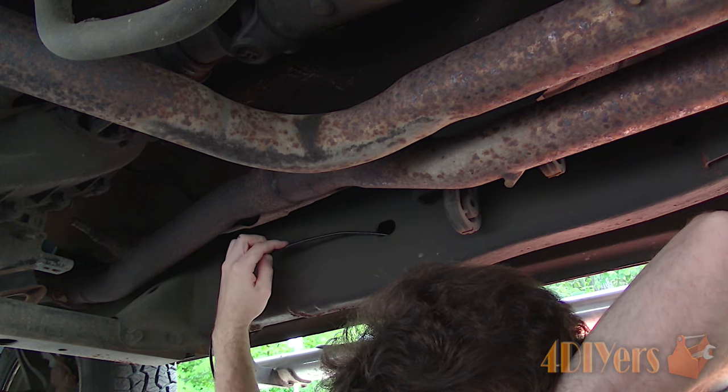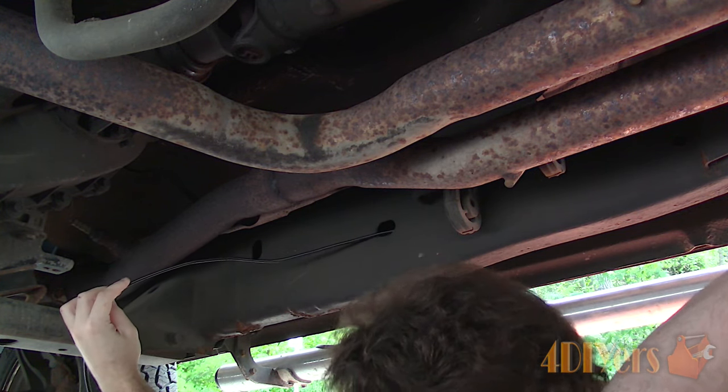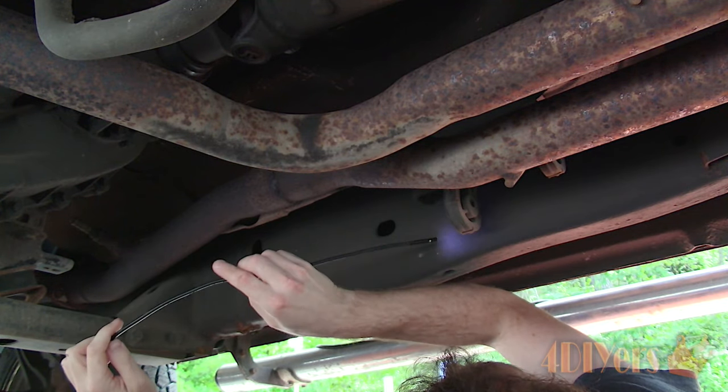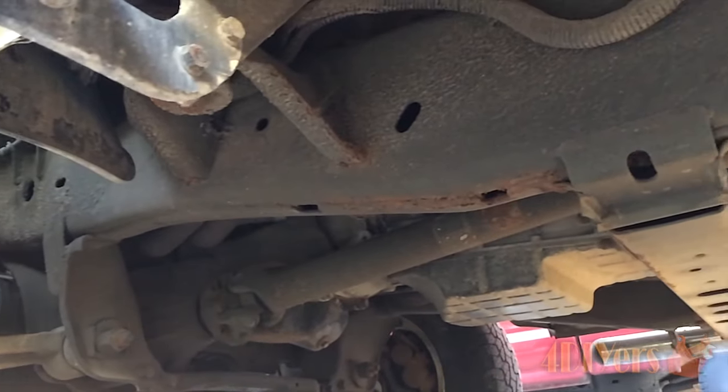The next question which may be asked is whether a frame can be repaired. Unfortunately it's a very debatable area. By far the best option is replacing a rotten frame, but that can be costly and you'll need the right workspace if you're doing it yourself. As for repairing a frame by welding, it can be done but there are many considerations. Many professionals such as body shops will not weld a patch in, as this affects how a frame reacts in an accident, jeopardizing its structure — it's a liability for a shop which is why they refuse such work. There are also certain methods for welding frames so cracks don't form. If a frame is rotten and repaired you may possibly have other issues in the future where another portion develops a hole, or if the metal you welded to is solid enough.